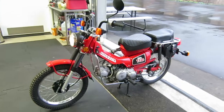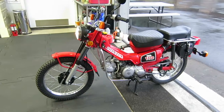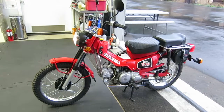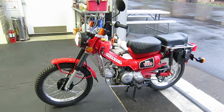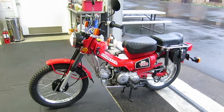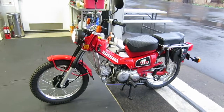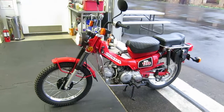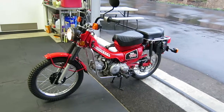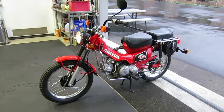These bikes did not get the electronic ignition until 1982. I would advise against getting any of the CTs, whether 110 or 90s, prior to 1982, because it had points. And if you went through the creek or other water, you had a chance that the bike could stop running because of the points ignition — whereas with the CDI ignition, they're bulletproof under weather conditions.